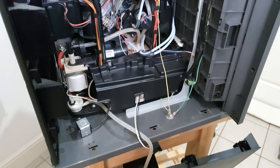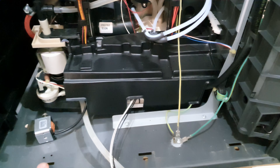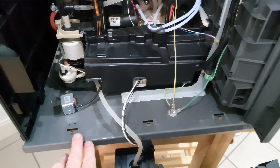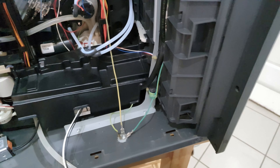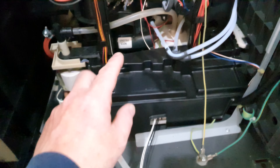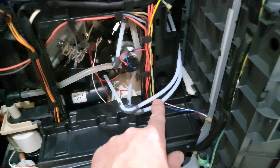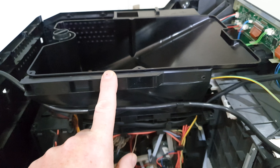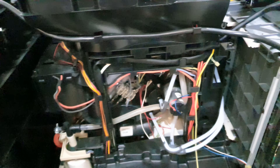Carrying on — the sides are all off. They're held on by three clips at the bottom and attached to the side wall. Once you unclip these they're quite loose, as they don't screw in; they just clip down. I was checking the tubes and they look really clean — the water intake tubes were fine. The milk tube was dirty but a calc and clean sorted that. The harder tubes were very clean as well. I had the bean hopper off too — that's quite easy, you just lift it off; it's got a couple of clips on the other side holding it down.